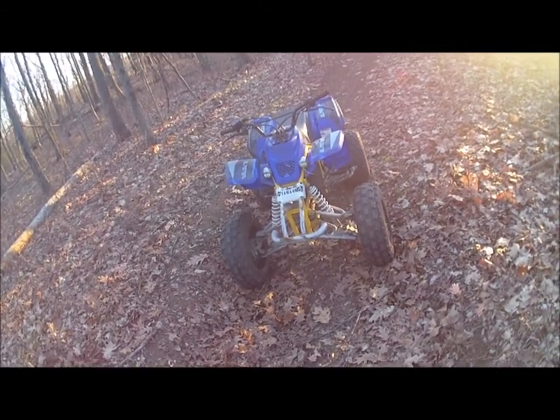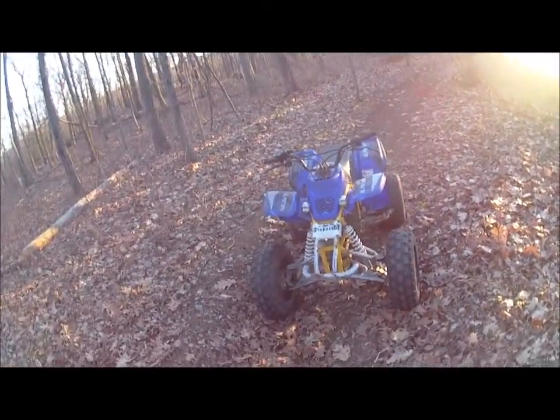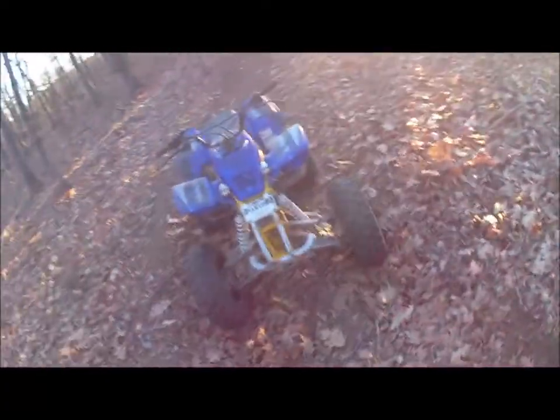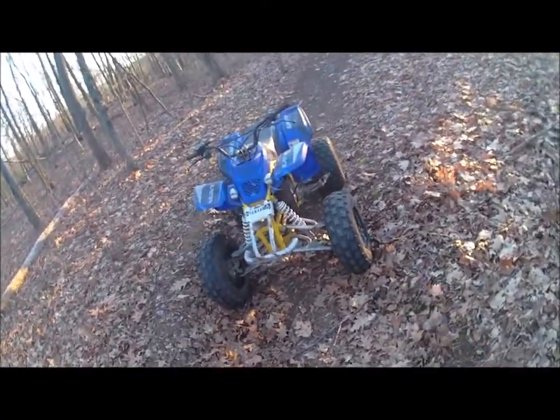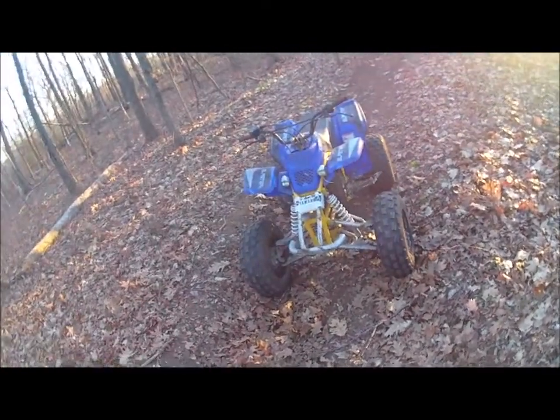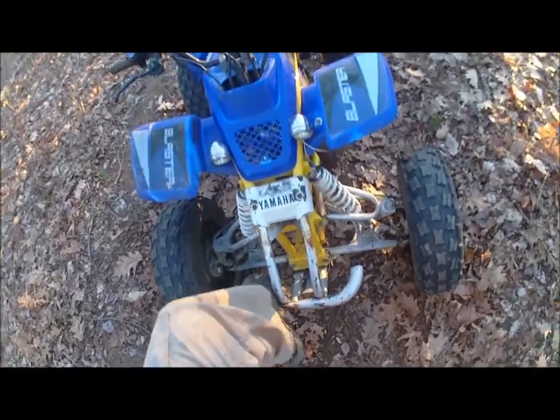It's a nice machine if you're looking for a cheap alternative. Normally when I sell these, they're like $600 to $700, and I'll do minimal work to them. If they have a blown top end, I'll get them for $200-$300, put that $75 into it, then put in the cables and cords that are missing on this one. I'll probably put a back brake on it and I'll definitely replace the front shocks. This is not safe to drive as it is — I do not recommend running an ATV with blown shocks because it could really cause some damage. That's how you can tell — it's almost like a trampoline.